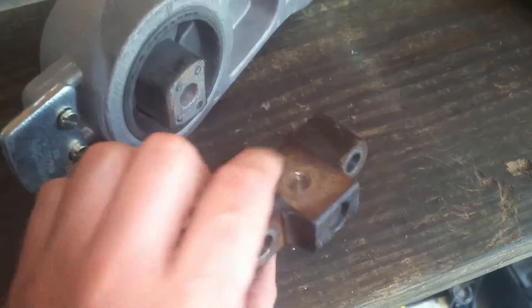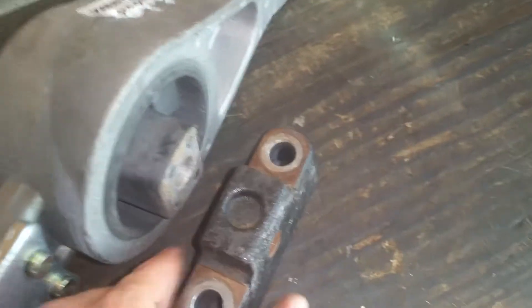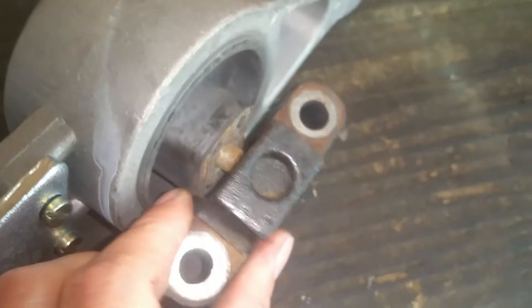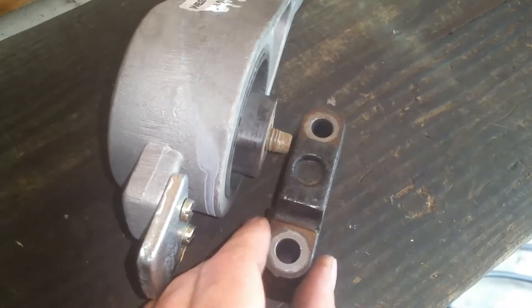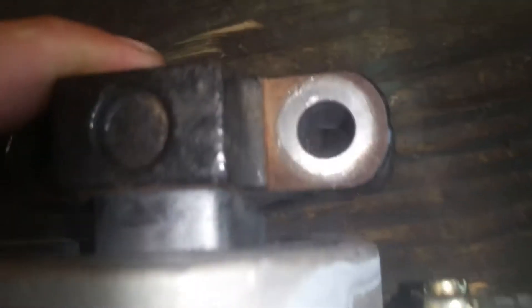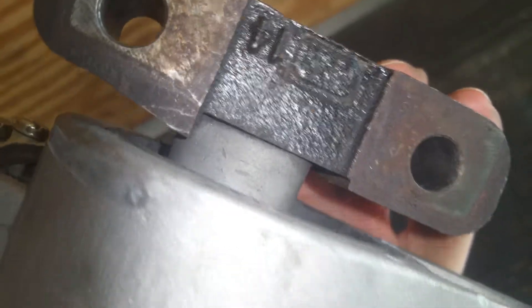So we're putting the new one onto this first. Notice the difference there — it's got a little indentation and a machined side. That's going to go towards this, and you'll notice this end doesn't stick out, but this end does, just so you don't get confused and put it on backwards. It's not a bad idea to use some medium Loctite if you want. We're just going to lift that up and fasten it on right here and get it really tight, then we'll work it back down into the car. So we got that tightened up — you can see how this right here sets against that flat spot that's machined there, so it keeps it nice and straight.